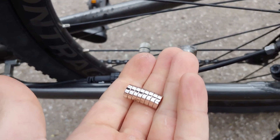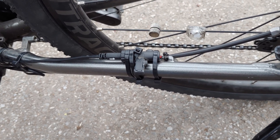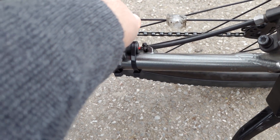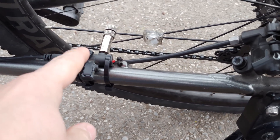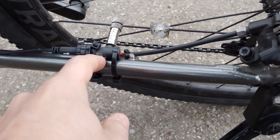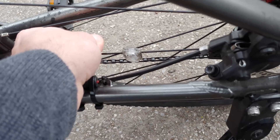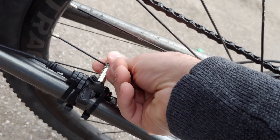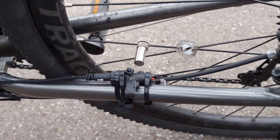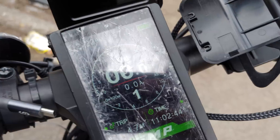This here is a set of magnets that I use to hold screws on my screwdriver when I'm working on machines, and I just happen to have a couple of them at home. I'm going to take this set of magnets and put them right here. Now I'm going to extend the length of my hall sensor. The issue was that since this mount is broken, I could not get the hall sensor close enough to the magnet for it to detect it. However, with my patent-pending buffeting speed detection extending tool — which will soon be available on store.rossmanngroup.com — the hall sensor is now going to be able to read the magnets as it goes by, because it has been extended.